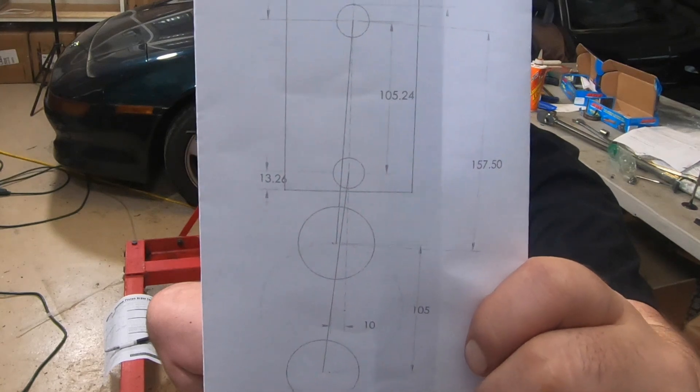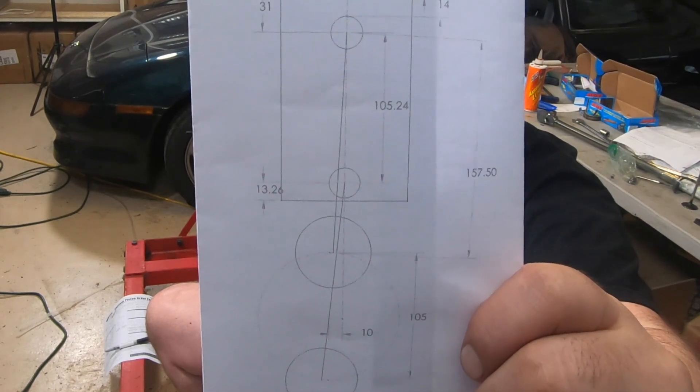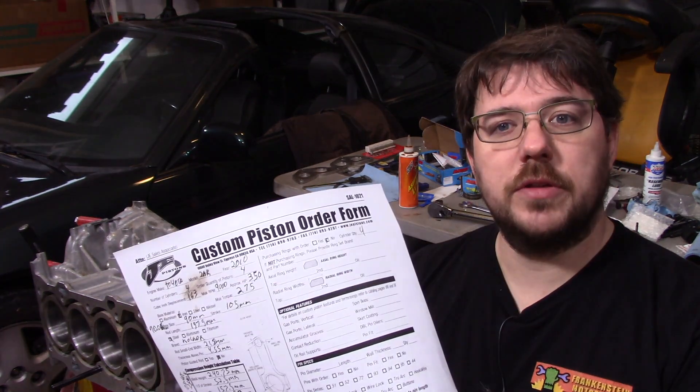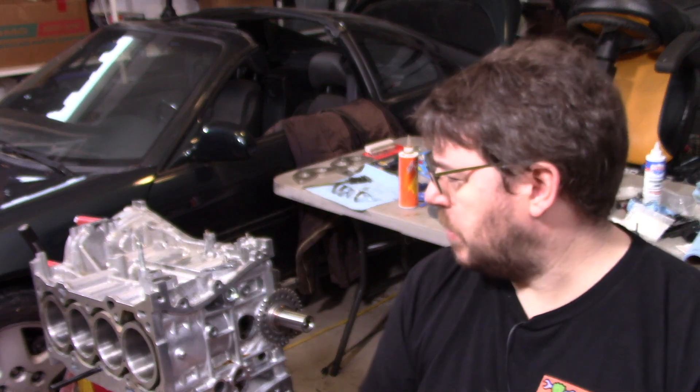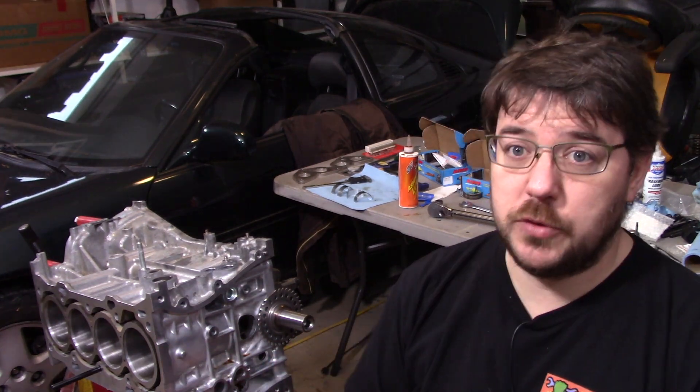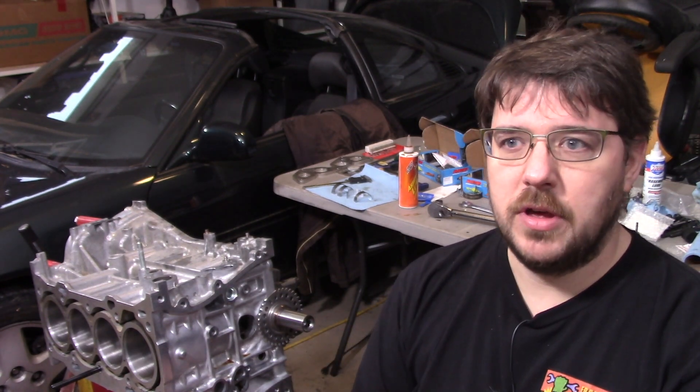Finally, something neat — I was making this chart to figure out where everything goes. Interestingly, because of the 10mm offset, we're actually gaining a quarter millimeter of stroke. I just thought that was interesting. The other thing it shows is that we've got 14mm for the ring pack and all the lands, which is more than enough — so hopefully we'll be safe and won't end up with broken ring lands. I'm going to keep working on the custom piston order form. Hopefully by next time I'll have some pistons, potentially some head stuff. Please remember, this is my first time building a custom performance motor like this. I've put together parts from catalogs before, but it's entirely possible some of this stuff I'm going in the wrong direction. So if you know more than I do, or you've got some things I might want to look at, comment about them — I want to have an open discussion so I can end at the best result possible. That's it for today. Thanks, have a good day.